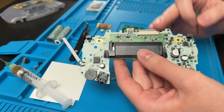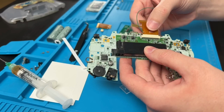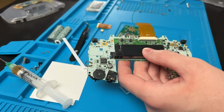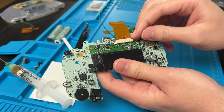So my Game Boy uses a 40-pin connector. On the GBA, there's the 32-pin and the 40-pin. This kit comes with both ribbon cables, so don't worry. Either way, you're going to want to slide it in like this to where the wire is soldered in this spot here, and the touchpad is sticking out just above the link port. It'll be like this for the 32-pin. And I'm just going to go ahead and lock these 2 tabs down.